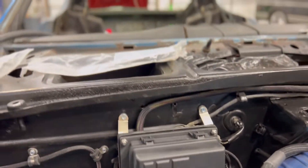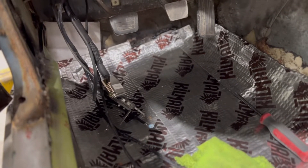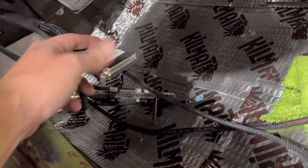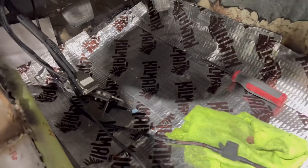There's that junction box. We'll go inside and I'll show you what we're working with. We've got these that'll run to our fuel pump, and then that silver connector is for your ECU, your MegaSquirt ECU. You do have to take that connector apart — there are two screws on it, and then this piece comes off and allows you to push it through the firewall. You also get a vacuum line that runs into the ECU directly to your MAP sensor, which is your manifold absolute pressure.